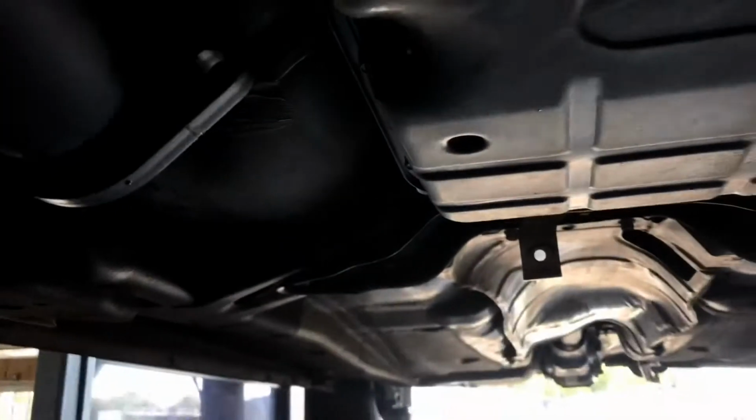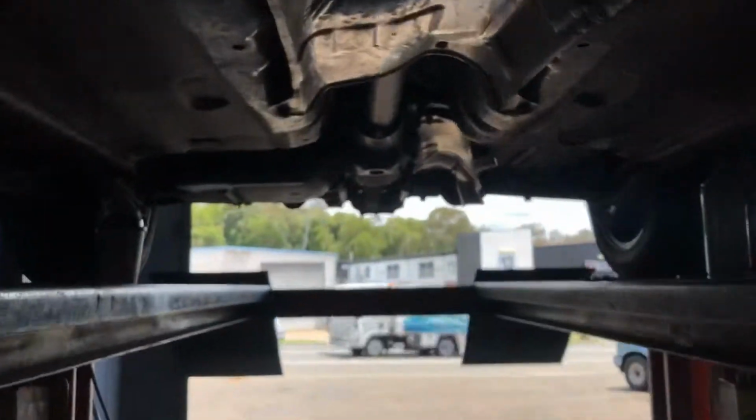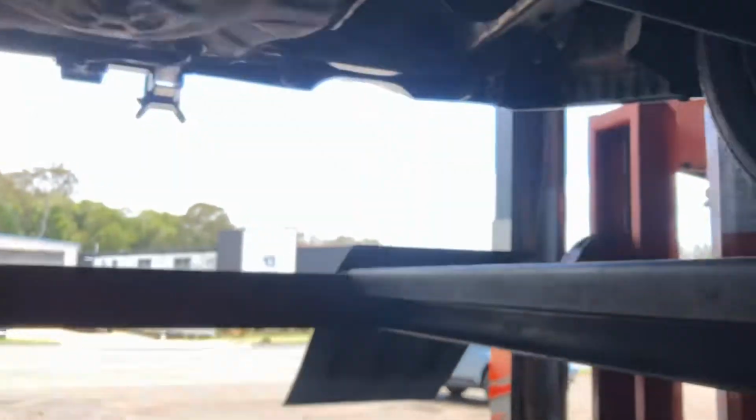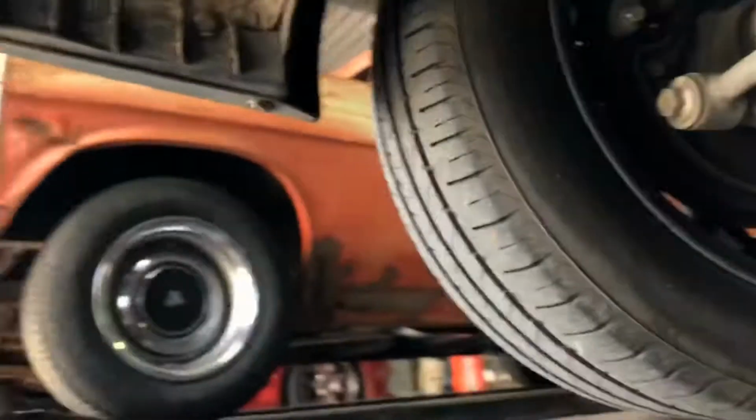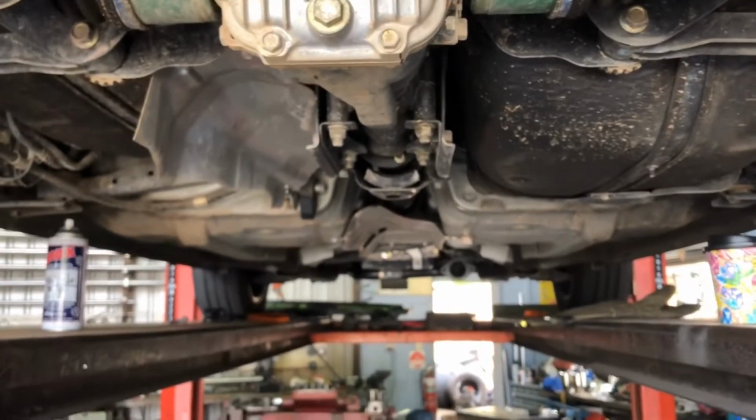So yeah, I'll go ahead and I'll get the rest of these bolts in there and done up nice and tight. And we're gonna do a nice, neat, simple high flow cat and a 2-inch system on this car. The EJ20 loves a good 2-inch. Your 25 wants a 2.25-inch or a 2.5-inch, depending on your noise volumes you're looking for out of the car. So it is time to get after it.